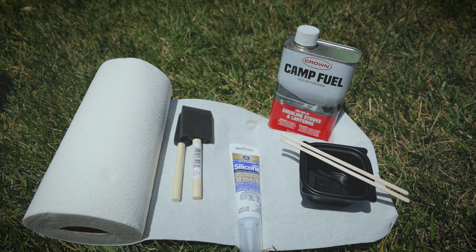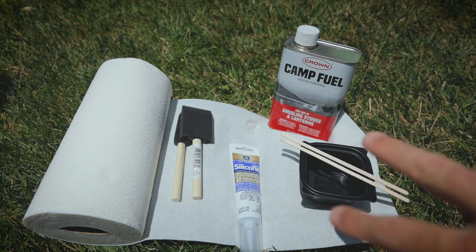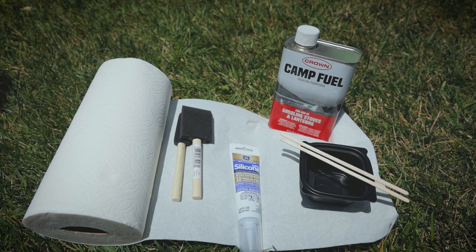Now you can also dilute silicone with mineral spirits, but unfortunately in California I can't seem to find mineral spirits anywhere — I just checked Home Depot the other day and still couldn't find it. Essentially what you're going to do is make a blend of the two that allows you to actually paint the seam sealer on, as opposed to squeezing it out and leaving a bead. You always want to dilute your seam sealer so that it paints on — it'll just make life a lot easier whenever you're seam sealing anything.